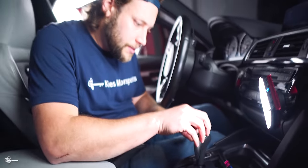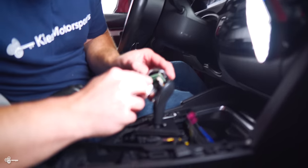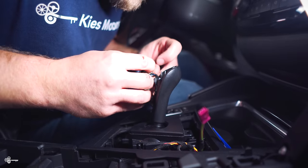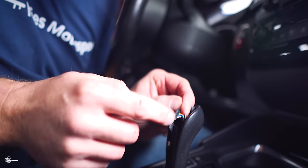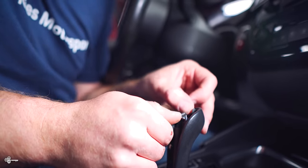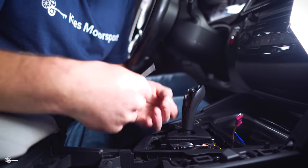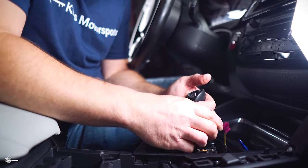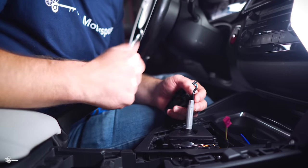Put the screw in the cup holder. Then once you do that, this whole piece right here is going to flip up, but there are electronics connected to it. So we're going to carefully disconnect this — just like that — and put it in a safe place. A little tip to remove this from the little board: just take your nail on the outer side and pop it from one side, then work it back and forth until it's completely off. Now take a T25 and remove the screw here. Then be very careful and slide this whole thing up. It is a little tough to do — the trick is to just not rip off that plug. You're going to have to use a little bit of force, but once you get it, you'll be good.